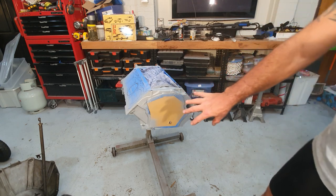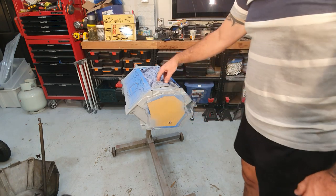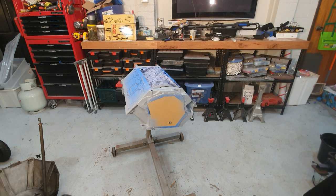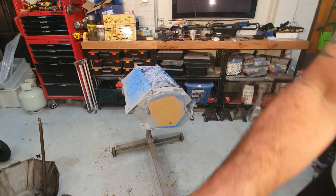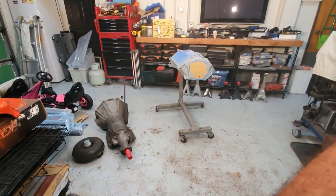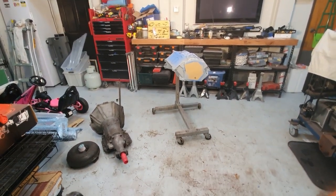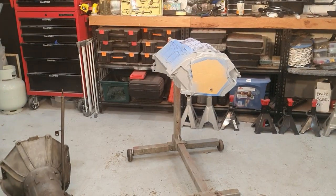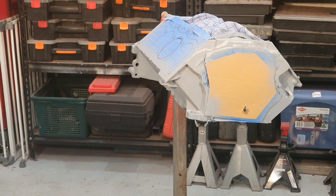Like I said, I only put these temporary on the front, temporary on the bottom. I just chuck a rag in the valley there to keep everything out. A tiny bit of overspray in there is not so bad, but you really don't want to get that stuck solid with paint. Try and keep them as clean as you can. Let's zoom in a bit for you there. All right, that's the engine done. So it's in primer.